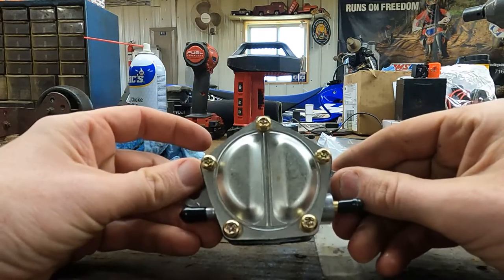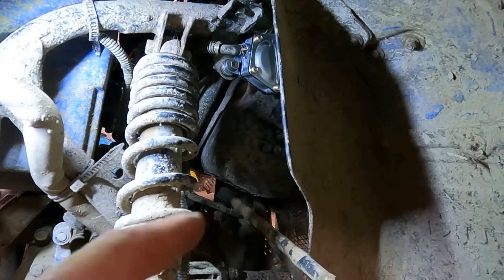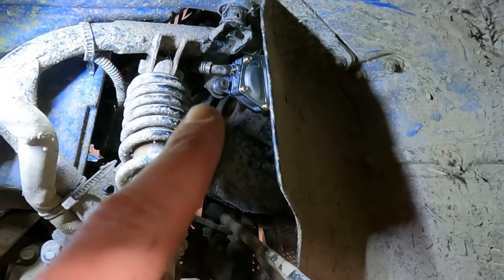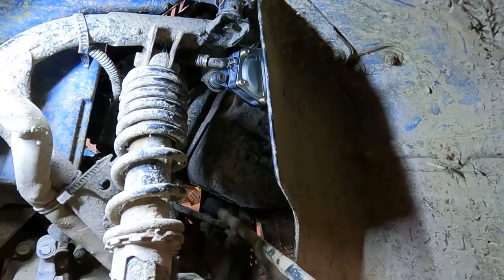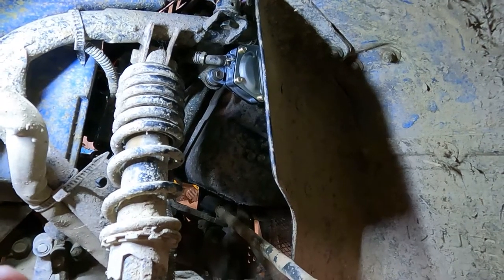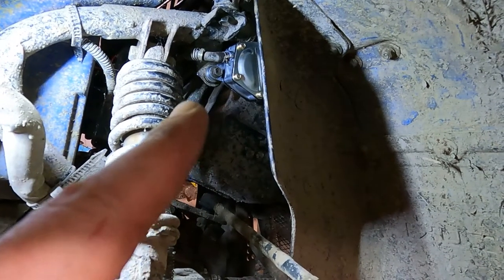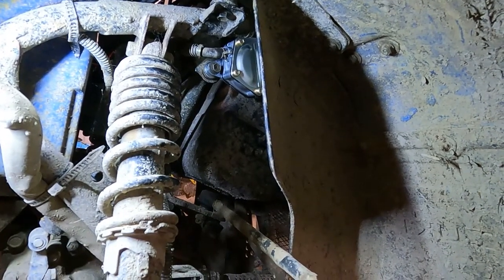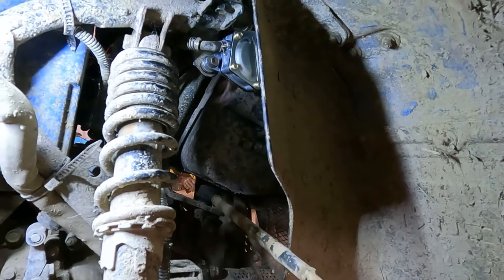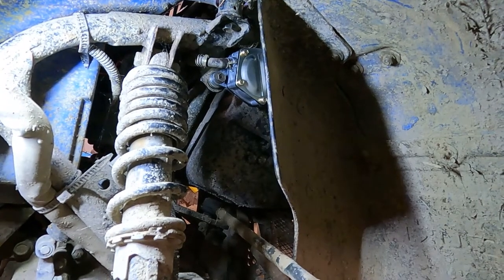The new one's in. A couple tips: this one had plastic caps on each end and when I pulled them off something started leaking out. I took a piece of fuel line and stuck it on the inlet nipple and blew through it with my mouth to push as much out as I could. Definitely do not put an air gun to it — too much pressure. And don't try to blow into the outlet because there's a check valve in there. I only had fluid on the fuel side, not the pulse side. Watch out for that because you don't want that stuff filling up your carburetor — it'll be the first thing pumped through.